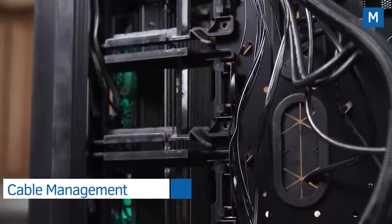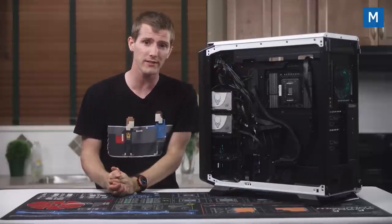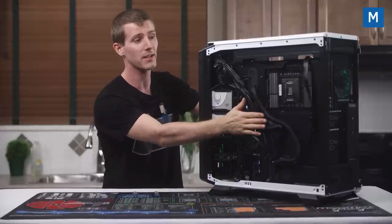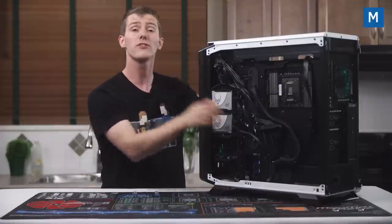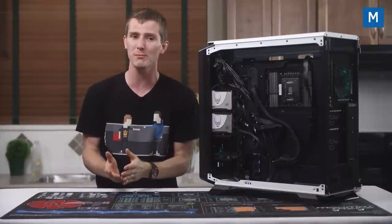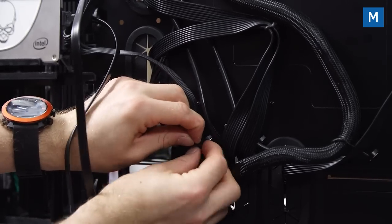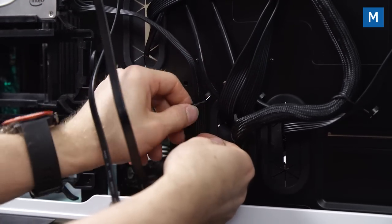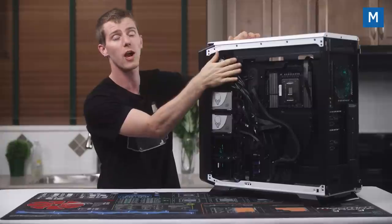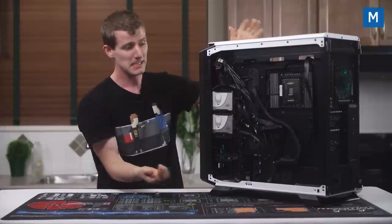For cable management, it's a matter of laying everything flat enough that the side panels close without interference — a little more difficult on this case due to the plexi back panel that will flex if anything is stacked too high. The good news is you have almost a full inch of clearance, so even a 24-pin connector is easy to hold in place. I recommend using twist ties instead of zip ties — they come wrapped around your power supply cables — and tie down to the cable management loops on the back of the case. They're reusable and easier to remove. Use the motherboard's onboard fan control instead of the fan controller, so you don't even need to plug in SATA power for it.